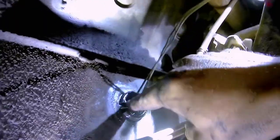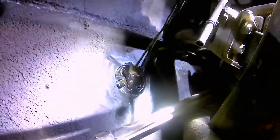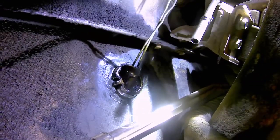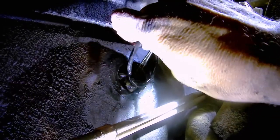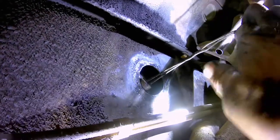It's not ideal to have it fall in there because it gets covered in oil, but that'll be cleaned up before we finish putting the kit together. This shows the little bird-mouth notches on the adapter. You can see the dipstick is now pointing straight up, when in fact on this specific truck it needs to rotate forward and go into that notch — that's an important alignment reminder when you put it back together. Now reach in here — sometimes you can get it out with your fingers, sometimes you need a pick tool — and remove the factory o-ring from behind the oil pan. That needs to come out and be thrown away; it will not be reused.